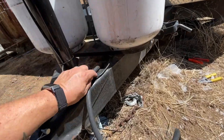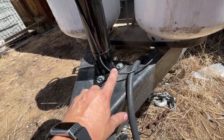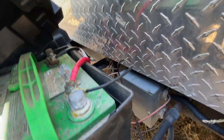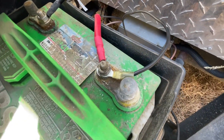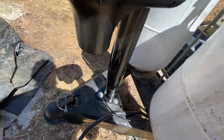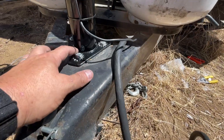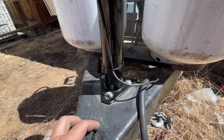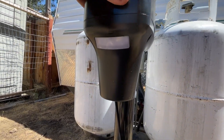Okay, now this is how it looks after. We have again the one wire that goes all the way to the battery — it already has a fuse on it. I just put a little eyelet on it and put it on the positive. It does come with three new washers that are designed to penetrate the paint so you can get the ground.